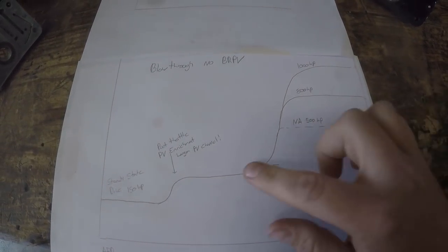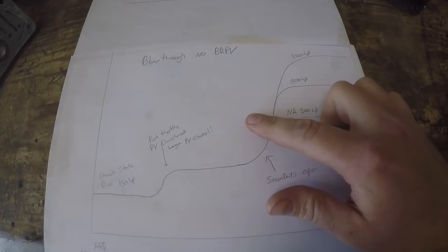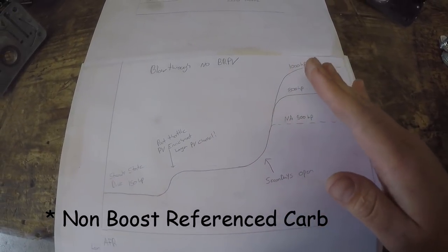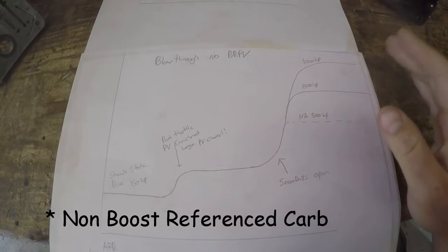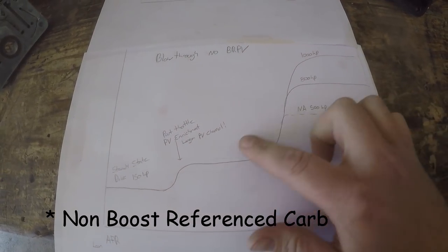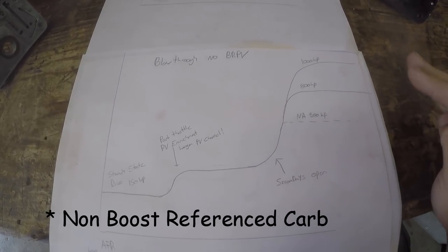When you're rolling up a hill building four, five, six pounds of boost, you're at part throttle not yet in your secondaries, so you're just cramming in boost and air and going lean — nothing is compensating in that zone. That's why you'll hear people say carburetors only run at idle, cruise, or wide open. If someone's running a big power setup with no boost reference power valves, they'll roll into it, get lean as hell, and then it'll be better only at full throttle.